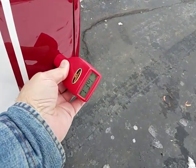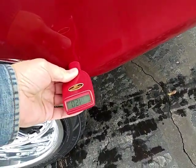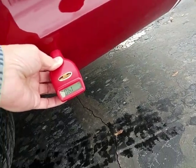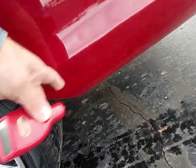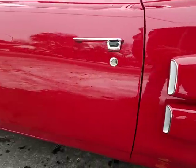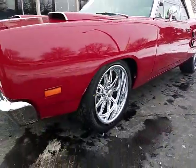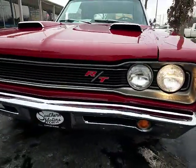Getting a reading of 12.19 back here. So 14 — somewhere in this area the filler thins out. 14.5 about four fingers in. A little bit of repair probably noted down there. The quality of the pinch welds is really nice — all the spot welds from the factory seem to be showing. Bottom of the quarter panel tabs are present, that's a nice feature. Chrome bumpers show very nice. The grille and taillight bezels and trim all show really nice.